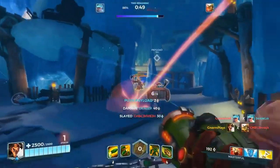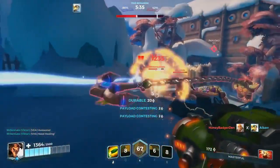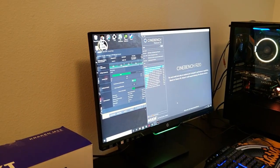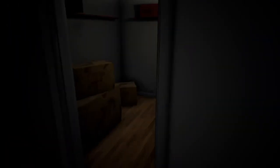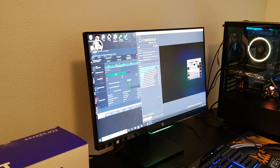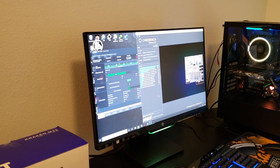Let's get in. I'm going to turn on Cinebench — there is no overclock at all in my system. My temperature right now is about 37°C, 36.75, with no real load on the CPU at the moment. I'm going to do a test on Cinebench with Ryzen Master being open so we can check the temps, and then I'll close it and run Cinebench again to see if it improves our score. Temps aren't looking too bad — we're at 52.5, climbing to 53, kind of hovering between 53 and 54.